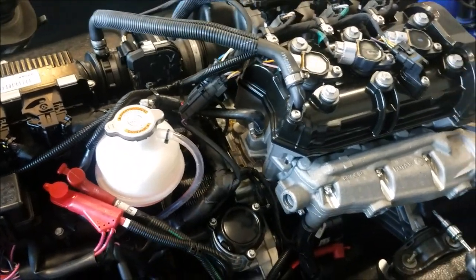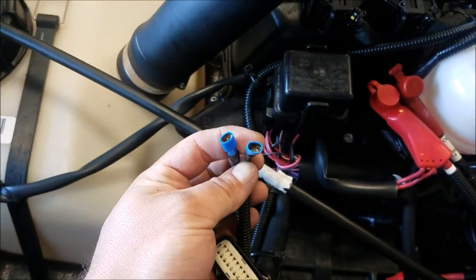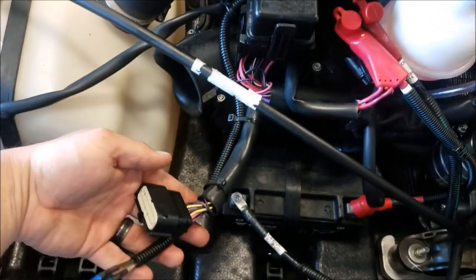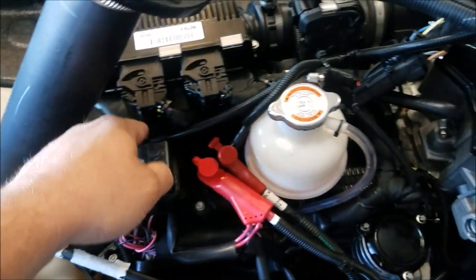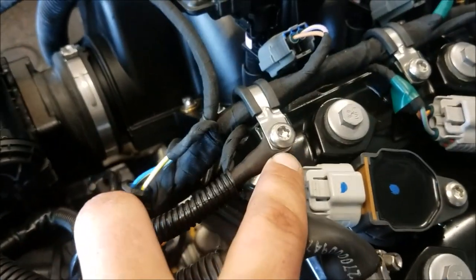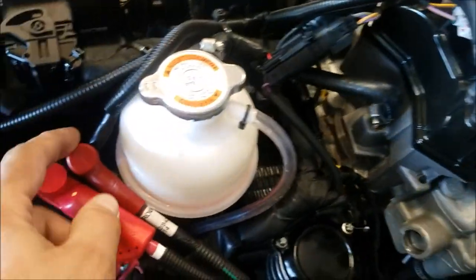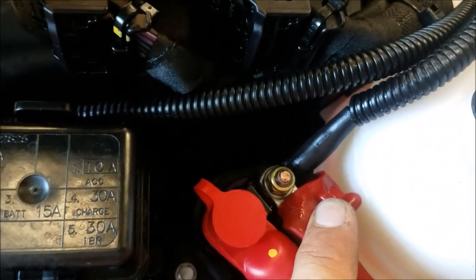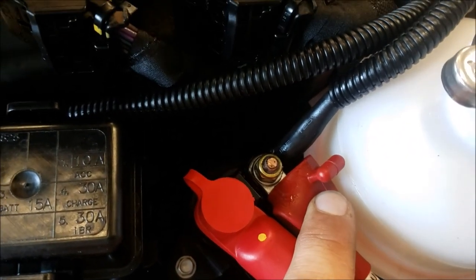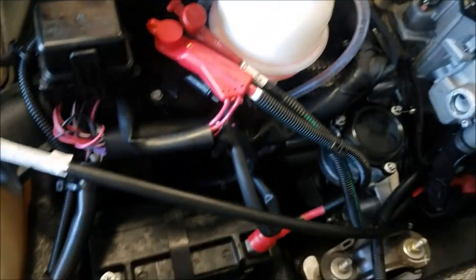This is how far I got — I got the top off and this is my hookup for the amp to get the power. I basically used wire loom, went through to the factory harness, went around over here to the top, zip-tied it, and grounded to one of the motor straps. Then the positive wire I got running right here — just took that nut off — and of course I got everything with anti-corrosion and shrink wrap on there.